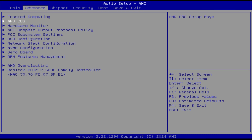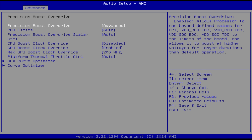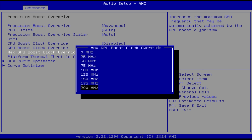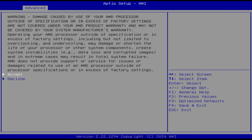The next thing I did was head back to Advanced, AMD overclocking. And from Precision Boost Override, we've actually got our Max GPU Boost Clock Override. Stock iGPU clock on the HX370 is 2,900MHz, so with a 200MHz boost up to 3,100MHz — not too bad. And that's all I did here from the BIOS.